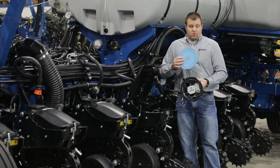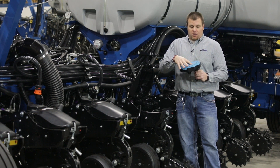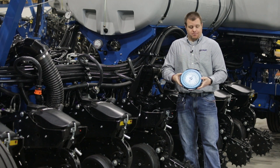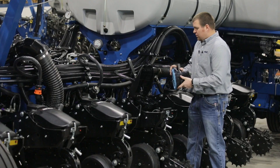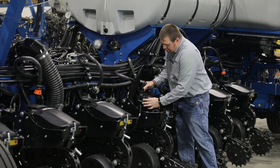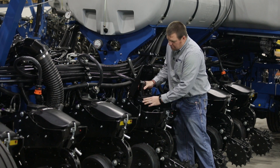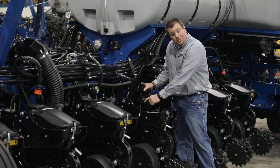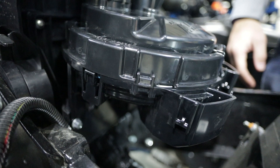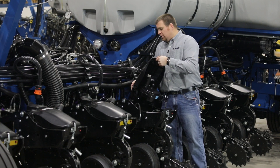The nice part is when you go to put the disc back on, you can slide your retainer spring on and simply press it onto the hub and it retains itself automatically. To put this back together and move on to the delivery tube — as you put it back on, it only goes on one way. There are alignment tabs to make sure you get it in the right location, and you rotate it to lock it.